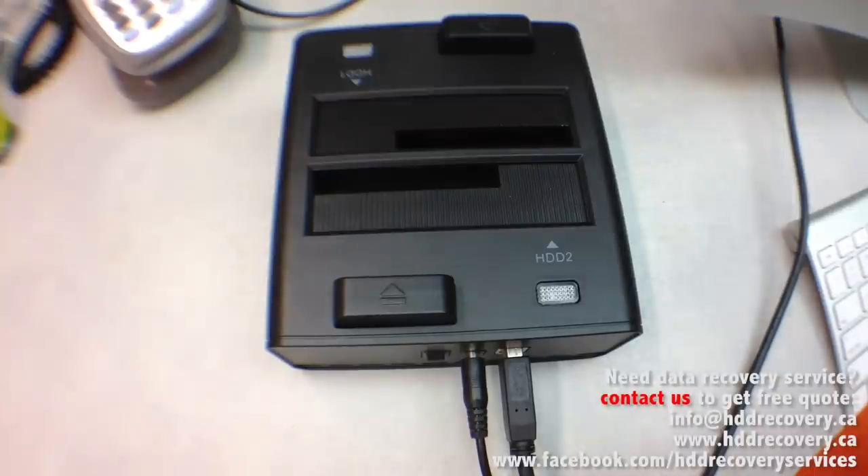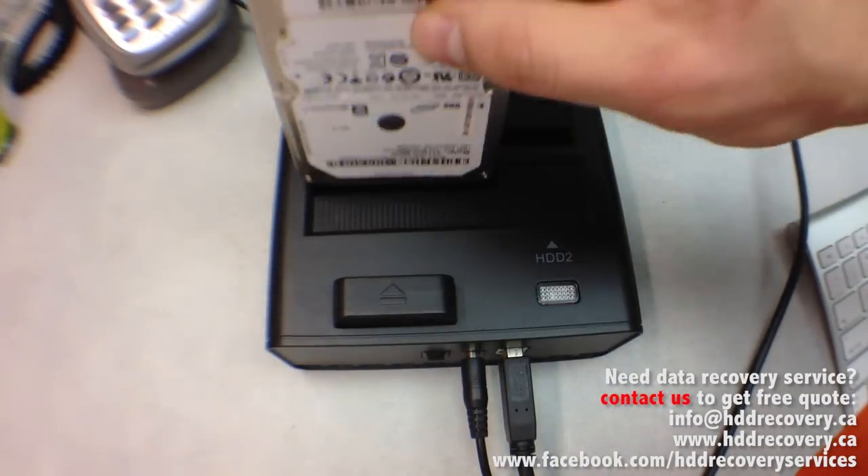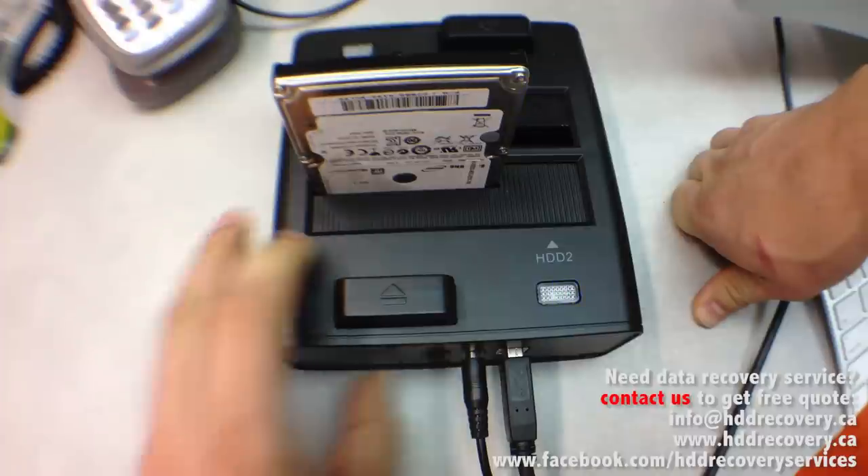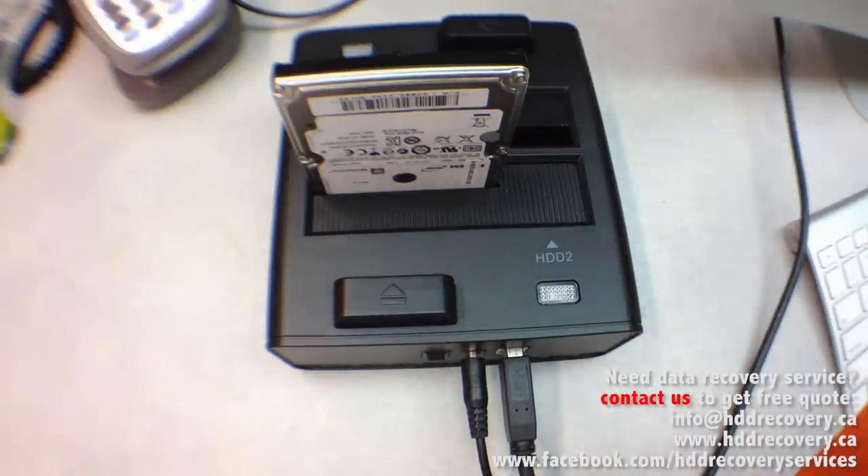Now that we have our caddy all set up and ready to go, we're just going to pop our hard drive in bay number two and power this thing on. It's making the exact same sound. Usually what that means is that the heads are not allowing the hard drive to spin because they're physically holding the platters, or there is an issue with a bearing or the spindle assembly. Most likely it is not a bearing issue — this kind of failure was very common with Toshiba hard drives. This is a Samsung, and I've never seen Samsungs fail this way, so I'm going to place a bet that the heads are actually holding the platters.